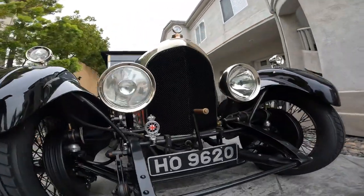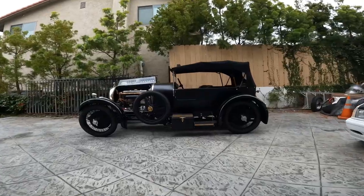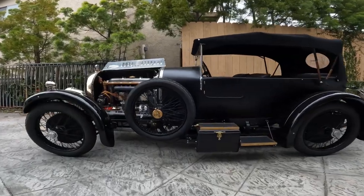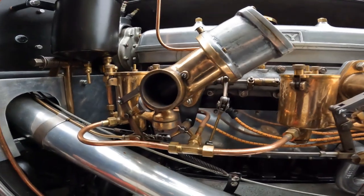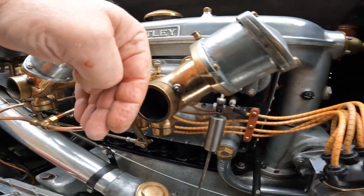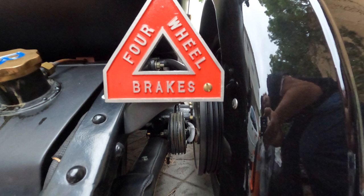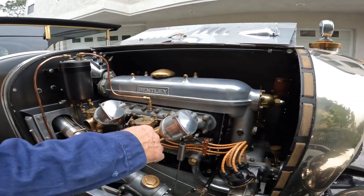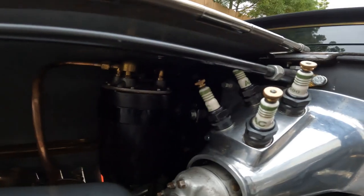Welcome back everyone. Today I'm hanging out with Arnold and we're actually working on this 1922 Bentley. It's a tour car, it's a three-liter. This Bentley was really ahead of its time, primarily because it's equipped with an overhead cam and it's a four cylinder but has four valves per cylinder. Remember, 1922 — four valves per cylinder is pretty far advanced. The vehicle also was one of the first to offer four-wheel brakes, and it's equipped with dual magneto distributors and these unique twin SU G5 sloper carburetors.